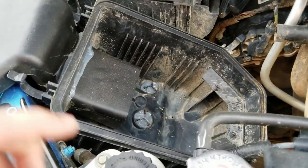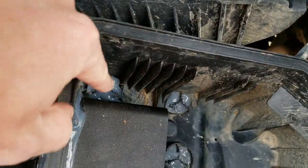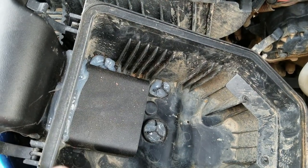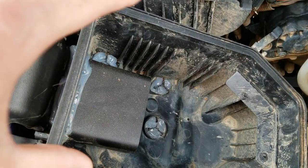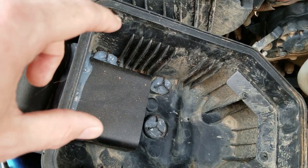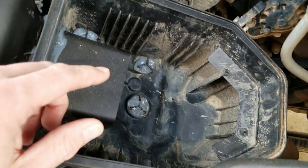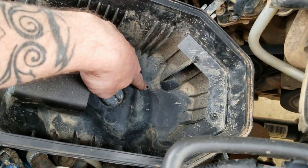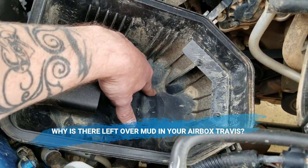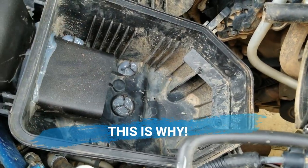I put a whole bunch of sealant on the outside and on the inside — better safe than sorry. What I mean by fully sealing it: see right there, right there, and right there? Those are actually the mounts of your airbox into your Jeep body, but they're also giant gaping holes — so we sealed those up. I did leave that one little tiny weep hole open. I'm not too worried about getting a lot of water in here; if I'm submerging the front end of the Jeep, I don't plan on submerging it for a long period of time anyway.